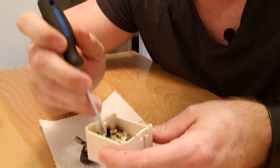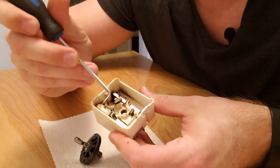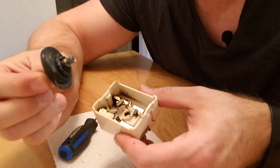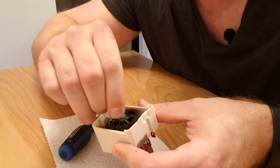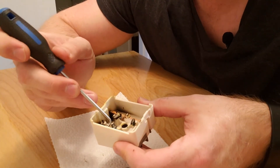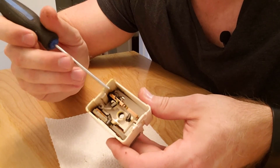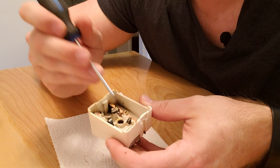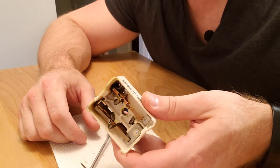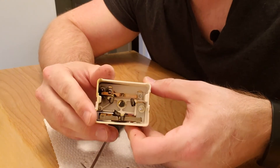That's what was happening there — just an inside look at how these switches work. It's just bi-metallic strips that heat up and flex when they heat up. This part turns and pushes down certain pieces depending on which position it's in. Everything's visible now, but this switch is toast. Once it starts arcing like that inside, it's just going to keep doing that. There's no point in un-sticking it and putting it back into your stove — it might last two weeks at best. It will re-weld itself. That's how stove switches work.